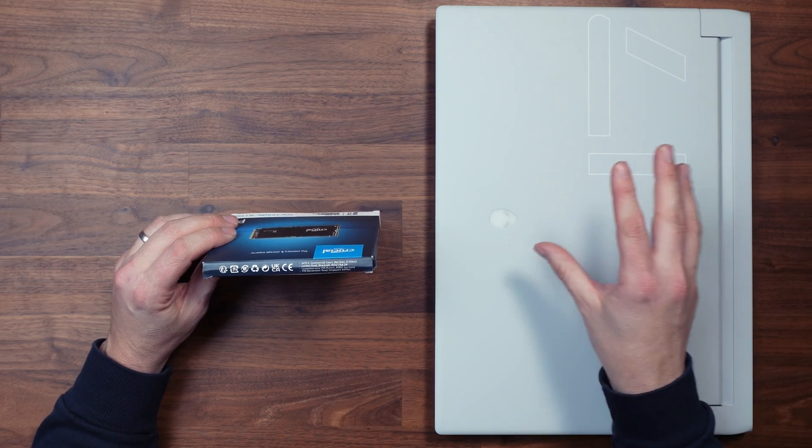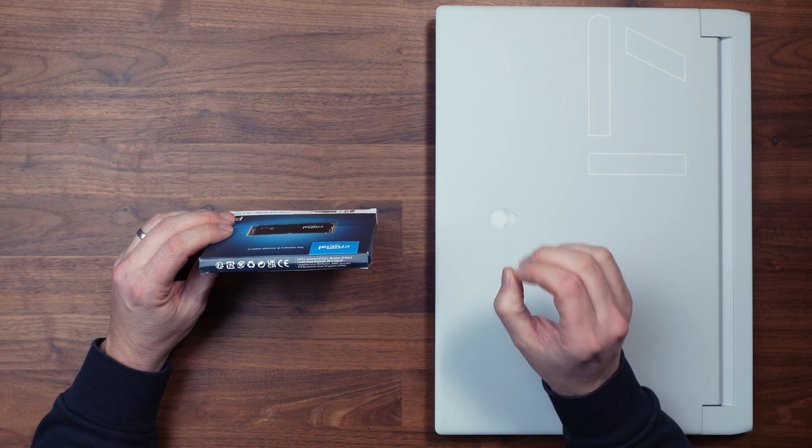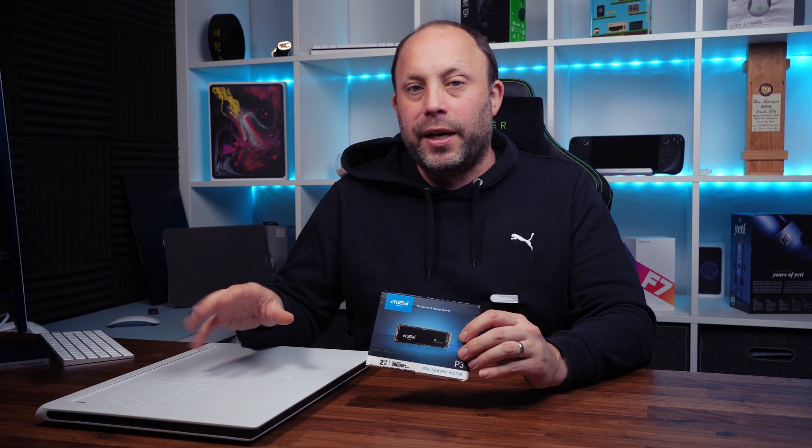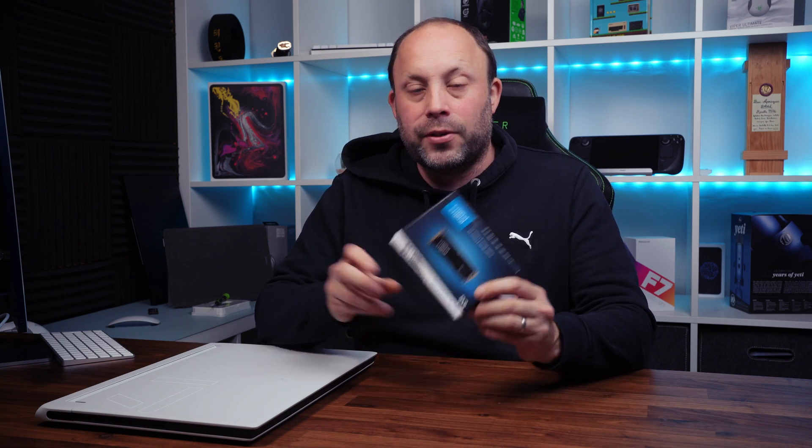If you've got a modern laptop with a fast PCIe4 SSD as your primary drive, your OS will boot incredibly quick and anything you do on that drive will be amazingly fast. But very often these laptops or motherboards will have more than one SSD slot, like this Alienware here that's got two. So if you're populating that second slot, there's no point putting an incredibly expensive PCIe Gen 4 drive in unless you need that extra speed. If you're just loading games or storing files, putting in a slightly older but much cheaper Gen 3 drive is a great solution.